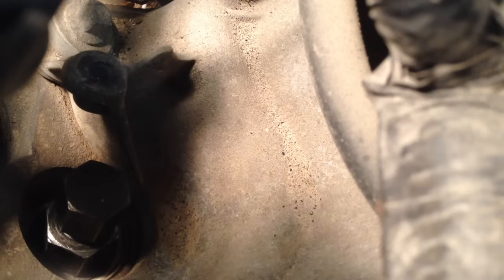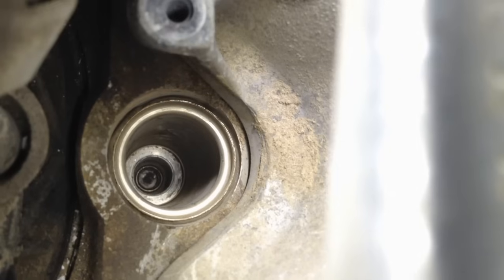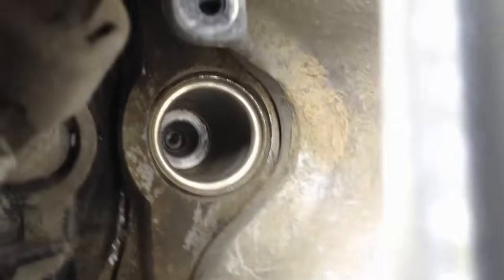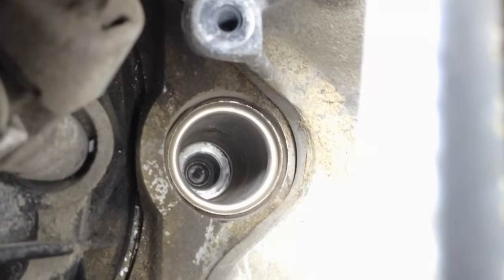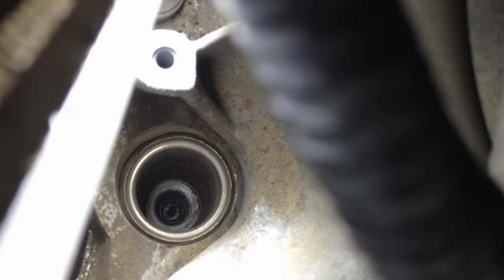At that point, keep pressure on the forcing screw and extract it. Okay, now you can pull the whole thing out. Hopefully you can see it's much further down in there — it's no longer flush. It's still caught in there, but we now have room to get bite into that shell and extract it. After you push that porcelain down, blow it out again because there will be a lot of chunks of porcelain in there.